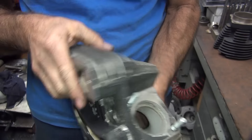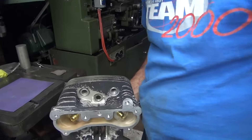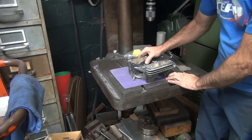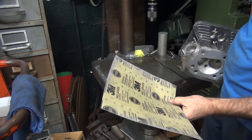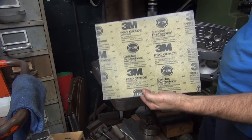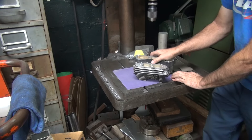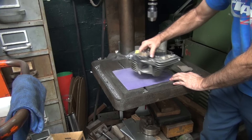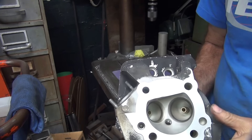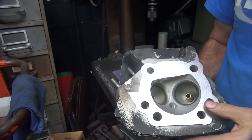I've already previously sanded this side because the head was kind of warped before. So now we just come over here to our handy dandy surface table, which is high quality sandpaper on top of our drill press table. Just give it a few swipes here — this is 120 grit, which is fairly aggressive. Change the head angle each time you do it. Doesn't take much to flatten it right out. You can see the nice even crosshatch pattern in there from the sanding, so you know the head's dead flat. That just takes the high spot off the machine mark and gives you a nice plateaued finish for the head gasket to bite into.